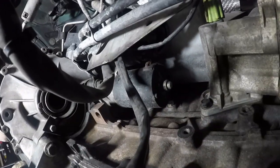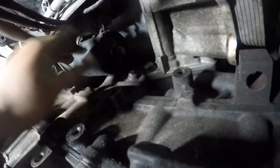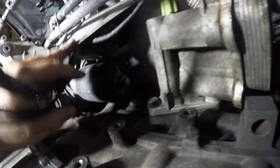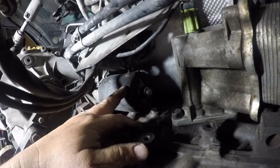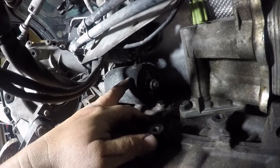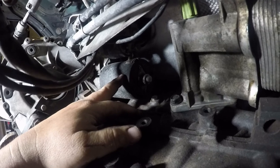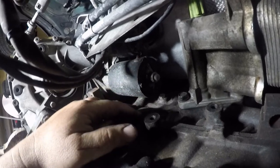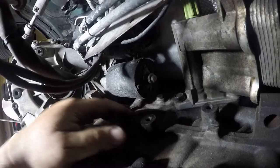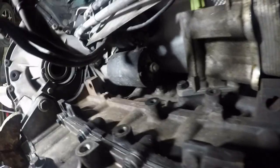We're going to take out this bolt for the starter. I'm going to take off the wires and figure out the wiring — it's kind of dark under there. I may have to take off this heat shield as well. We do have to get the starter out of there. I'm thinking that since this starter is so hard to get to, we may just replace it, because it is definitely a common wear item and it is real hard to get to. Unless these things are a thousand bucks, I'm going to put a new one in there.